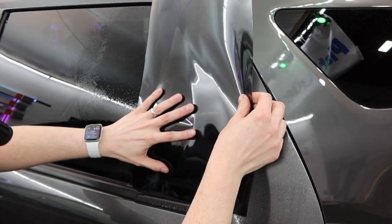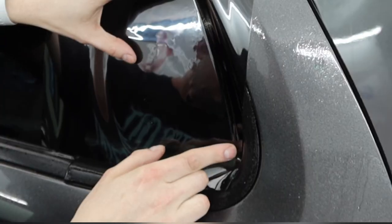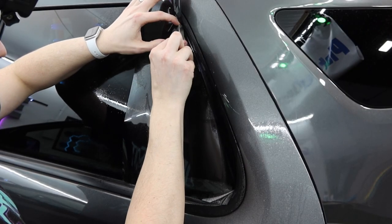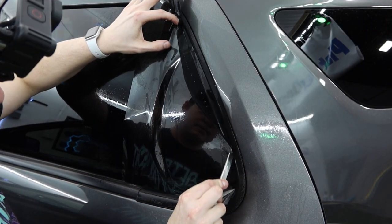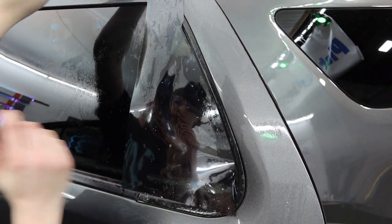Laying a bulk piece of film with a flat edge basically right on the edge at the bottom, you can overlap a little bit. Then shift it over so the right side of the film will butt up to that side edge. So when you cut this whole side, no film bunches up.